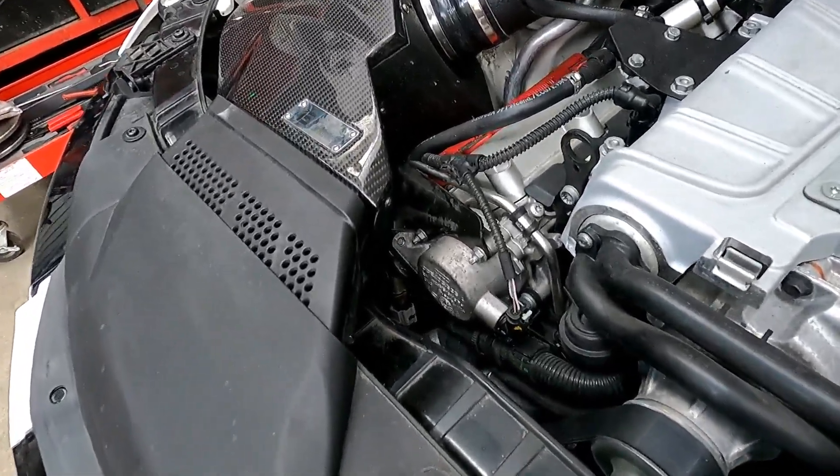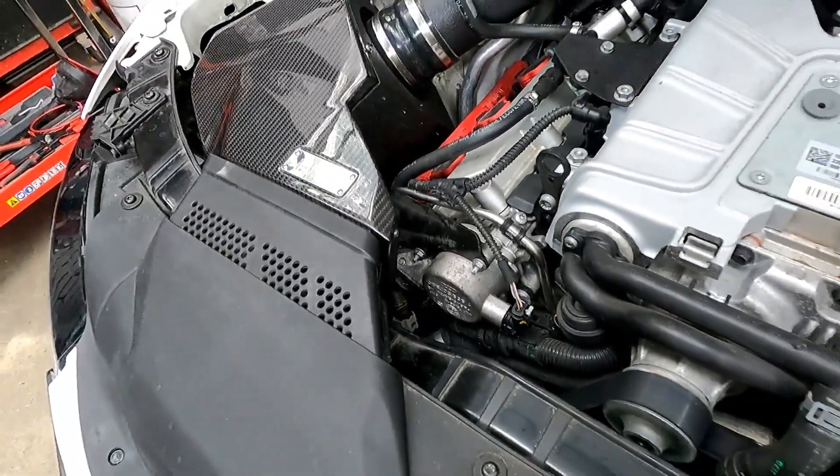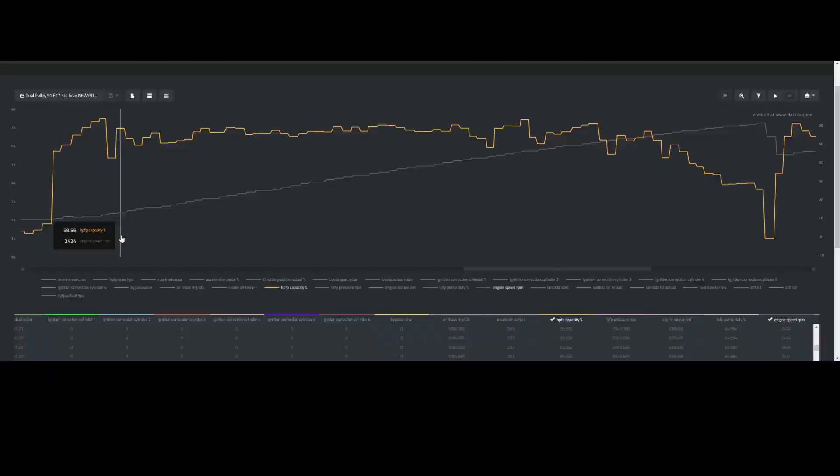Thank you to Kyle for the install. Now to head out there, do a data log, and see if we've fixed the problem with that high pressure fuel pump showing an extremely high duty cycle. I've got my Power Link cable connected. I'm in third gear around 2100 RPM in manual mode, full foot to the floor without pushing through the kickdown, to achieve a full log of third gear and check to see if this high pressure fuel pump install worked. Feels healthy — that's all it takes.